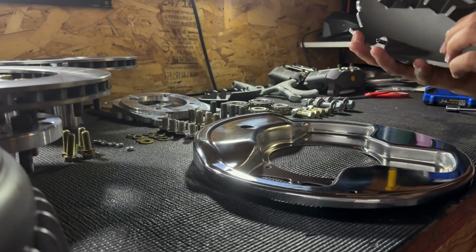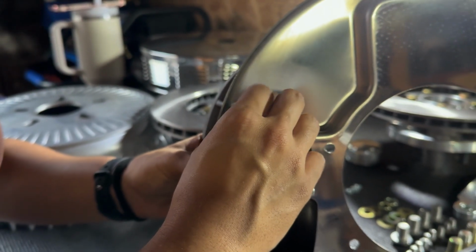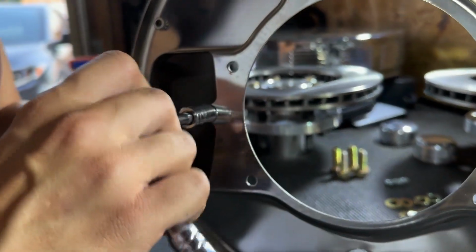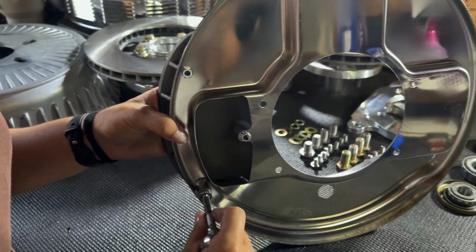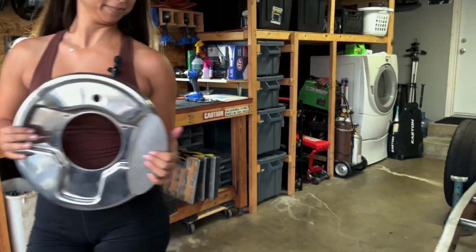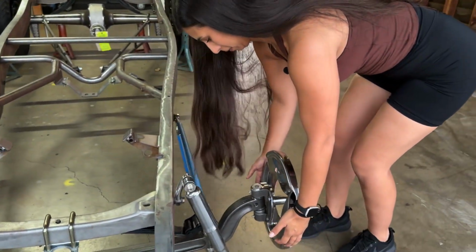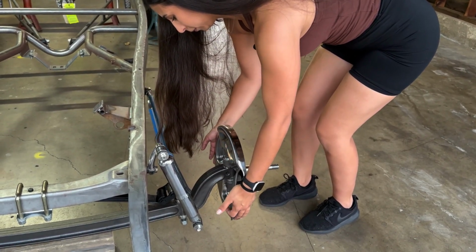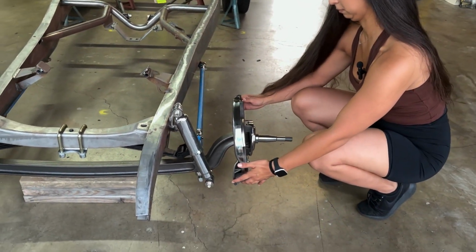And then this one. All right, so here's one of those kind of weird steps: you kind of just have to let these back plates float in order to give you the room later to bolt on your caliper. Good job. Yeah, it'll rotate all the way to the bottom because the fin's the heavier side.